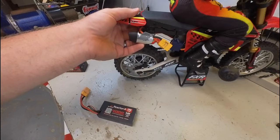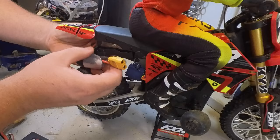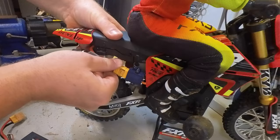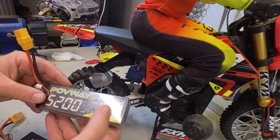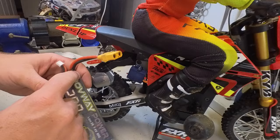Here is what I'm finding: just because the wires come out on the correct side doesn't necessarily mean they're long enough to actually plug in. This Povway, for example — even with the wires coming out the right side, I squeeze it up where it's supposed to go and I'm just barely that much too short to reach the plug. Even though the dimensions are correct and the plug orientation is right, the leads are just a little bit too short, so it doesn't quite work.